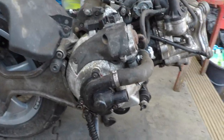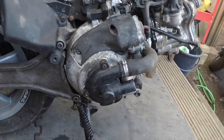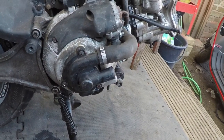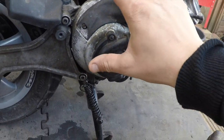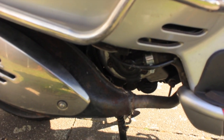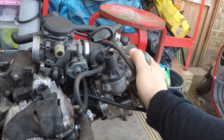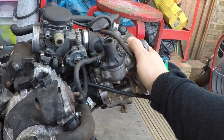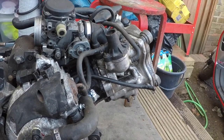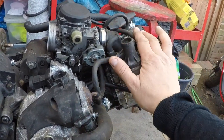Right then, so that's the engine himself. You saw in my previous video why we took this engine out, and we suspect a couple of problems. We got a problem with the water pump, there is a noise inside. Then we got a problem with the piston, because we got a lot of smoke coming from the exhaust, which I think could be a problem with the piston rings, but that's going in the next video.